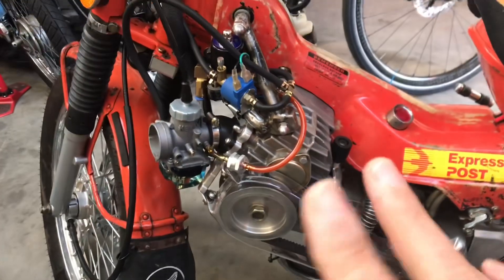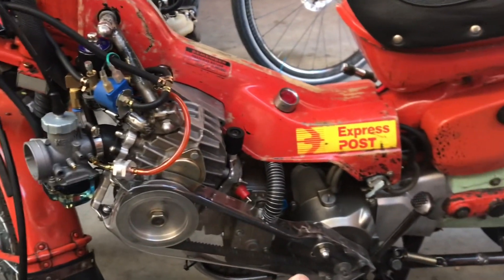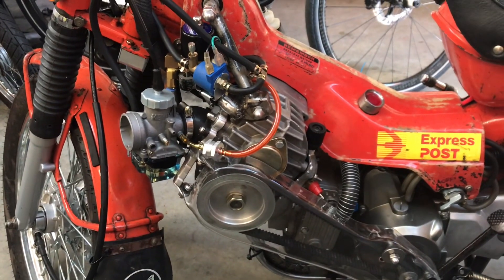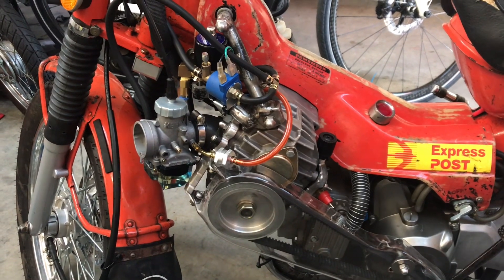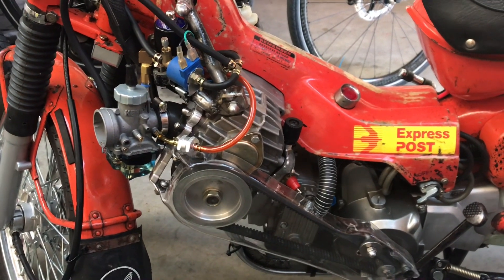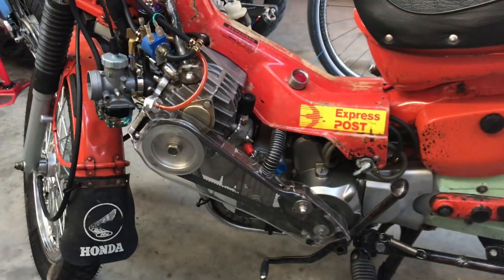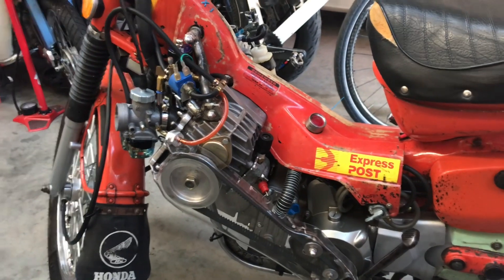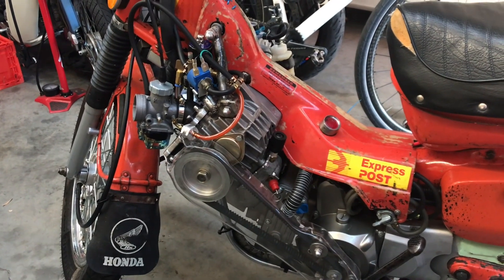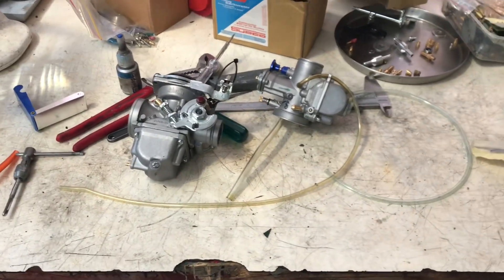It's a real borderline between enough throttle to keep the blower going and too much throttle for the automatic gearbox. It's a balancing point and I'm not quite winning it yet, because I don't think these little 140cc or 125cc engines are really meant to drag a big blower like that. Anyway, I'll take it on a test run. The main jetting when I'm off and going — I've been playing around with the pilot jet and I've pulled all these carburetors off so many times to get those pilot jets right. It's a real struggle.